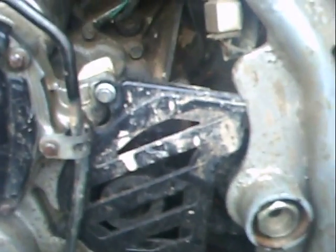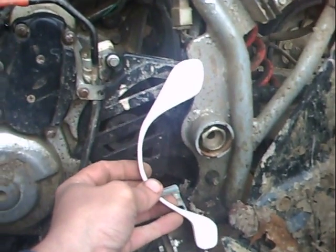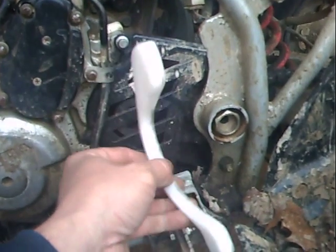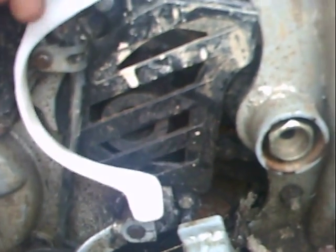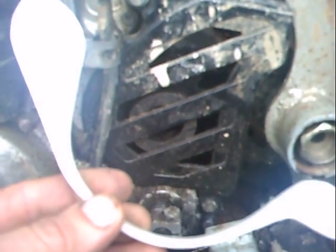And then on this one I made a case saver. This engine here is pretty good for throwing the chain right through the engine block. Here's one that I made, I made 2 of them. But pretty much the only way that this thing can bolt up, the way I made this one, is that my case is already broke. When I bought this engine, it was already broke. A piece of it's broke out right here. So the way it bolts up is it uses the bolt that would have normally went into the engine block. I just drill a hole in it, and I don't think it's fastened at the bottom. It just holds it there, and it wraps around in the engine there. So far I haven't lost a chain. This thing runs so close to the chain that I don't think the chain could really derail in there.